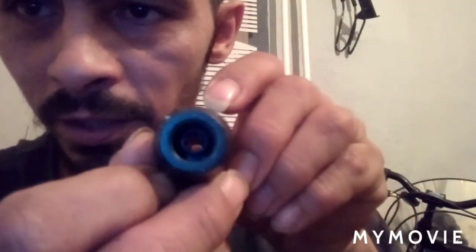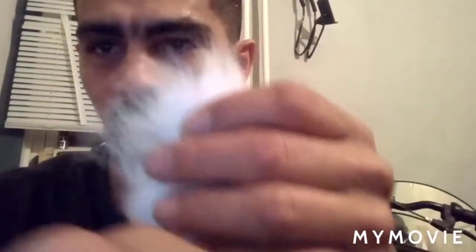What you do is put it in there and make holes through it, because both sides have holes you can burn right through. Just poke a bunch of little holes — big enough for a lot of air to escape — and do it on both sides. Then you take cotton and just take a piece like that, ball it up, put it right inside that hole. That's gonna create your silencer, your damper — something that's gonna damp the noise down.